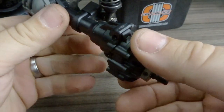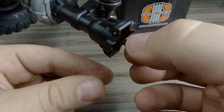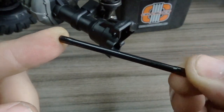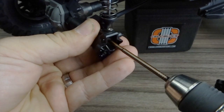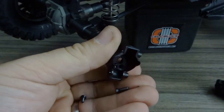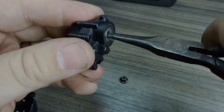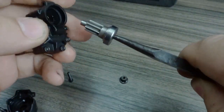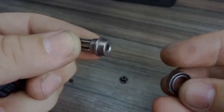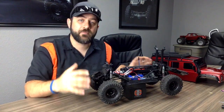This is the rear portal. Taking this off just to show you the differences, which are very small. When you take off this portal box the inner axle shaft has flat tangs on each side rather than the CV style axle. You can also see that the adapter on the end of the axle looks different than the C hub that we have on the front. It is again held on by three screws just like the front. The upper gear in the rear portal box is not retained by three small screws like the front axle — this one simply pulls out. That wraps up the front and rear axles showing you all the components that make up how they go together.